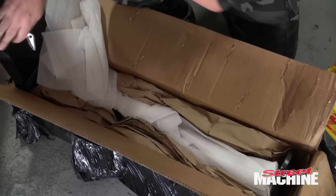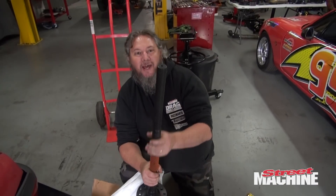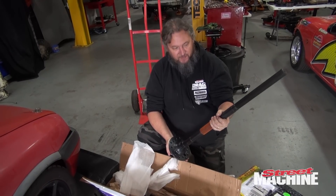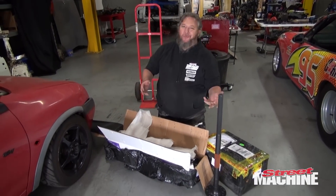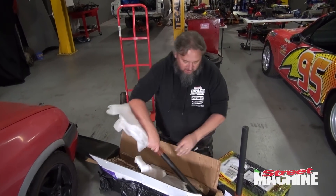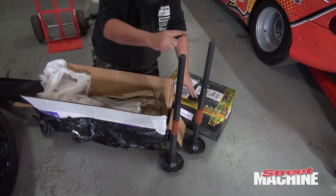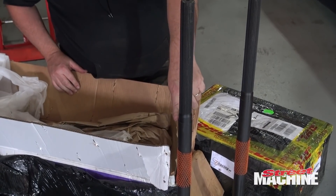I'm figuring these are axles. Look at them — these are some meaty ones. Multi-drilled. 30 splines of Volvo goodness. The standard axles are 27 spline and these are 30. They're not quite 31, which is kind of the performance standard for your 9-inch, but 30 is pretty damn good. They use these a lot in Jeeps for rock climbing upgrades and that sort of thing. They're a good-looking axle too. Look how long the splines are — certainly not going to snap, and it's got a long way to twist.